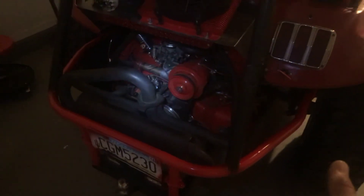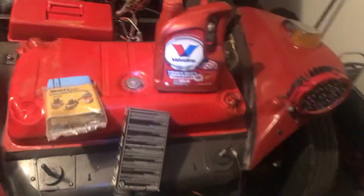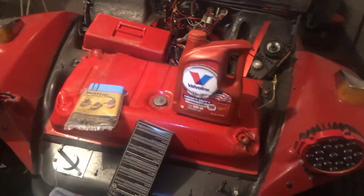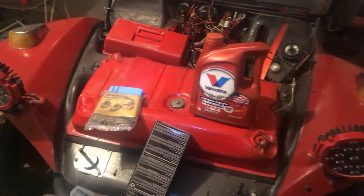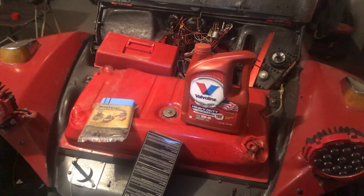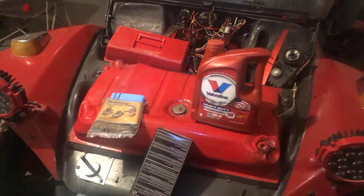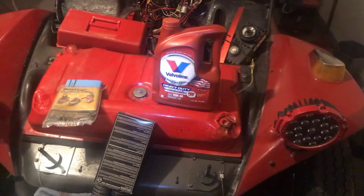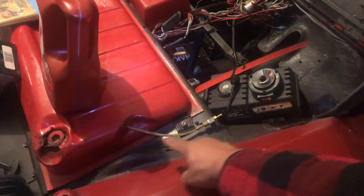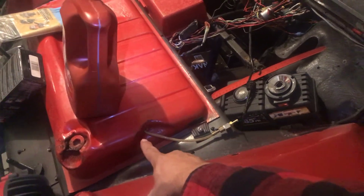Oil can reach 250 degrees and until then it's okay; after that turn the motor off and let it cool. You must run high-octane fuel — 91 — unless it's an emergency situation. It's an air-cooled motor and it can start pinging and knocking if you're not running high-octane fuel.